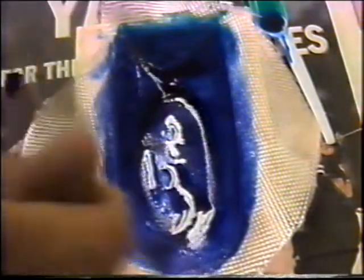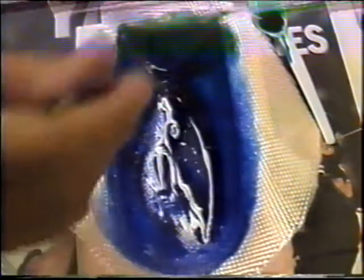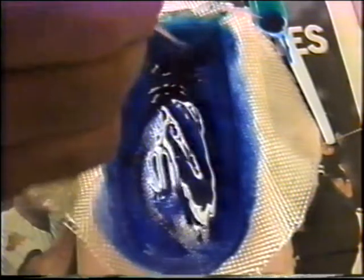E-glass, by the way, is just a fancy name for fiberglass cloth. It's the same stuff you can buy where you buy Bondo in the car parts store. Right there is where they have it. Any place that sells marine supplies will have it. Not a difficult material to find or buy. Not expensive either, by the way. You can do a whole cowl probably for a couple bucks worth of material. You'll have enough left over to do 8-10 extra cowls.